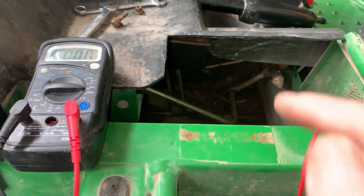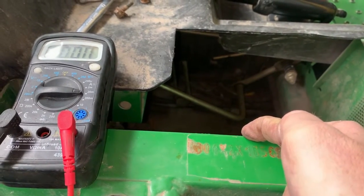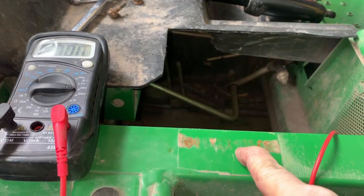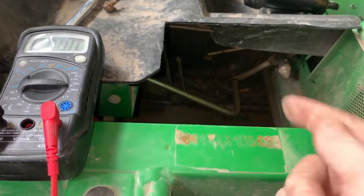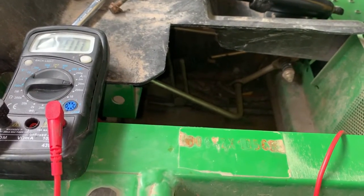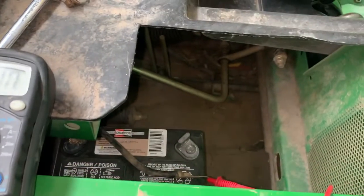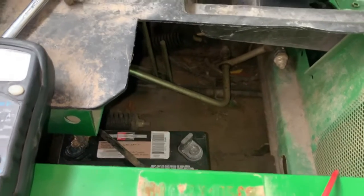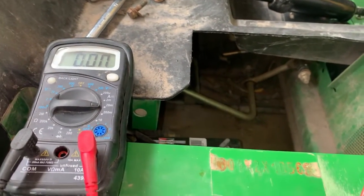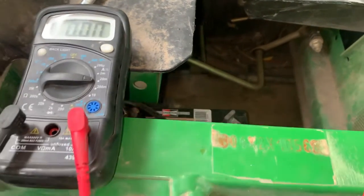What we're going to do is hold the battery cable to the battery, crank the motor, then disconnect the negative cable and do the same test with the meter. That should tell us how many amps are being put into the battery from the charging system on the machine itself. Note: if your engine has a fuel solenoid, disconnecting the battery will likely kill it.